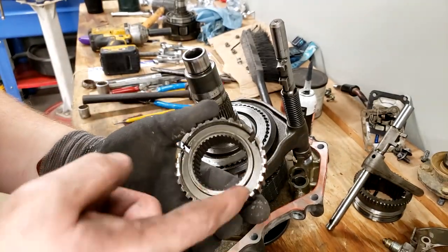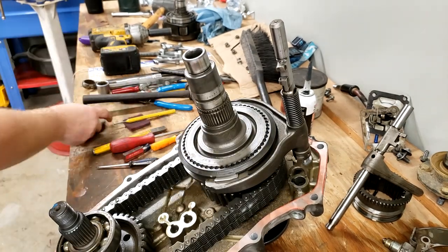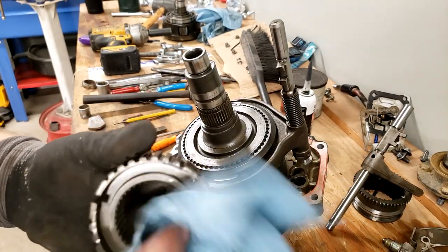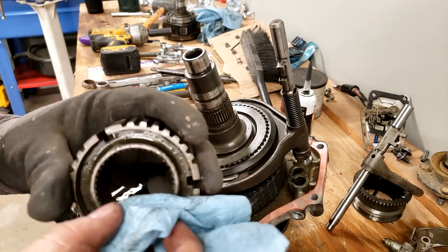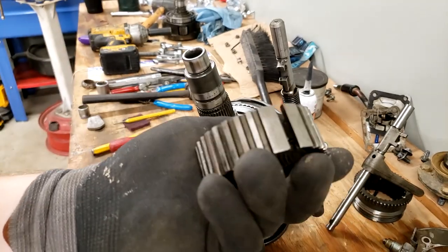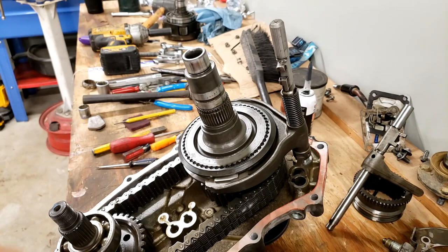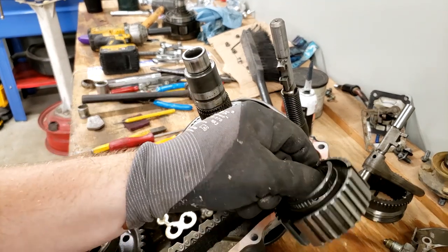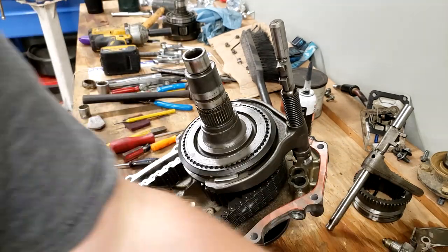Instructions mentioned some sort of clip on this, but I think they're talking about like a VF4 case or, I don't know. I'm assuming it's something out of a Tundra or a Sequoia. Maybe like an all-wheel drive 4Runner, but I don't know that they made those. But either way, we've got what they're calling the shift collar off, the alignment collar. We've got that off like they wanted. And we've got the clip, of course, that came off before it. We're going to keep those two together because I think they're getting reused on the new Northwest Fab case.